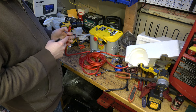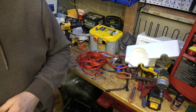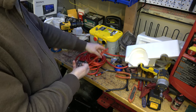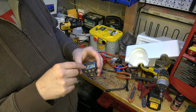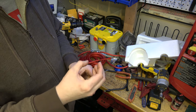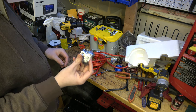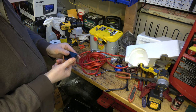We'll have plenty of thick wire. I was thinking — I think I have extra wire that'll be enough for both amps. What I want to do is have one come off of here going to the subwoofer amp and another going to the other amp, with this big lead taking power to run both those amps. Eventually this will actually go to a capacitor, and then from the capacitor to our subwoofer amplifier. I'm going to look into that and make sure I have that idea right. I may get another one of these for the ground — I should have bought two at Fry's.